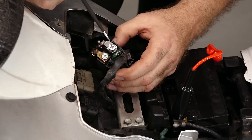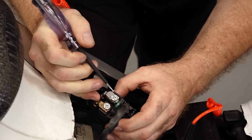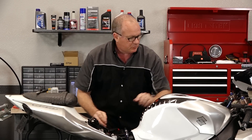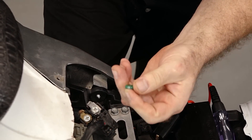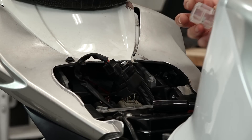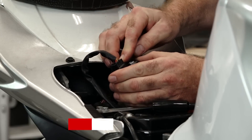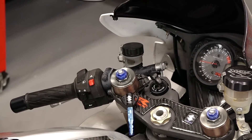Do we have battery voltage coming up top? Yes we do. We should have it over there as well, and we don't. So let's check this fuse — power on this side but nothing on the other. That's telling me that fuse is probably blown. And the filament is indeed burned in half — you can see straight through it. Suzuki is nice enough to include a spare inside this little plastic cover. Pop it out, go in. Look at there — she's alive now! Alright, that was a simple fix.